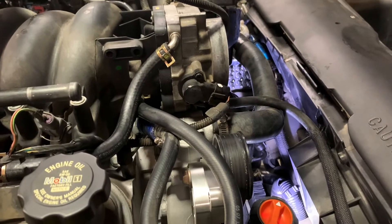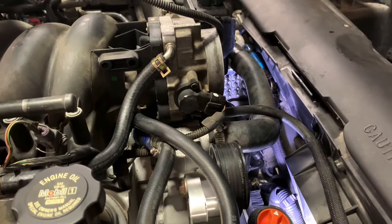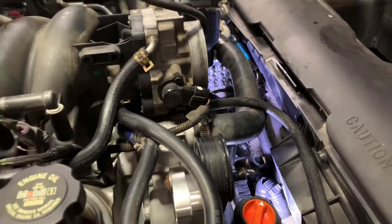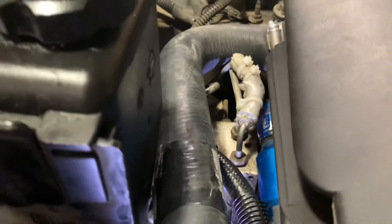But what's really happening is that the soldering joints on the coil to the circuit board are faulty. The fix for this is relatively easy. What you need to do is take out the electronic portion of the ABS module. You can see over here my ABS module block is still in place, including the brake lines. That's part of the reason it makes it easy — you don't need to disconnect these lines, which means you don't need to let any air into the system, and there's no bleeding that needs to happen afterwards. So all you're doing is taking off the electronic portion of it.